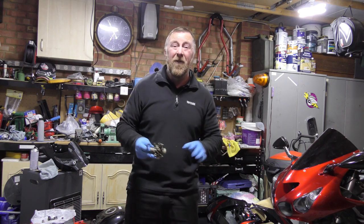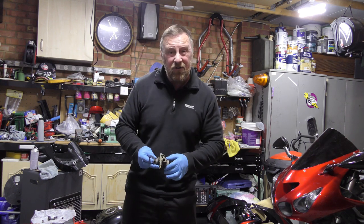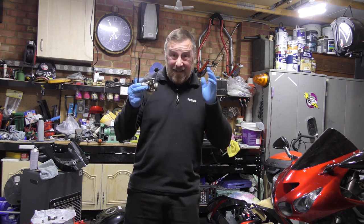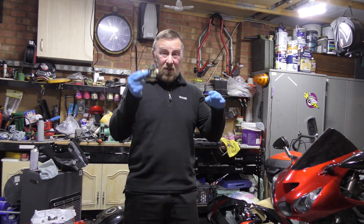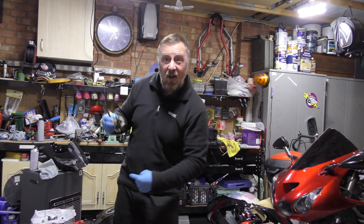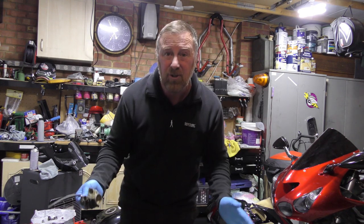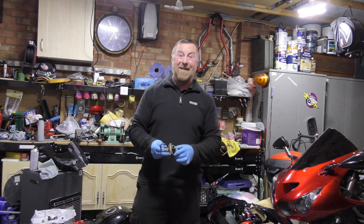Your wonderful bike that ran perfectly six weeks, one month ago, three months ago — the longer this stuff's in your tank, the worse it is. And it separates. When you're trying to start it, the fuel raises, the water lowers, and you're sucking straight away water into your carburettor, into your engine — really bad. I can't stress how bad it is.